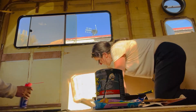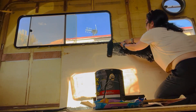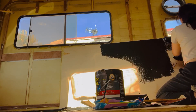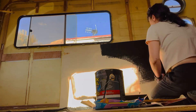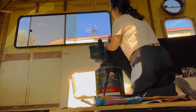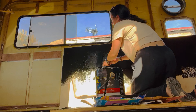I take all the pieces and make sure I'm sealing the sides, underneath, and the top. I had to do four coats — I take a brush, do the little perimeter, then pour the flex seal, take a roller brush and roll one side of the marine grade plywood, and let that dry while moving on to the next piece. We had three large pieces to fill the floor of the RV.